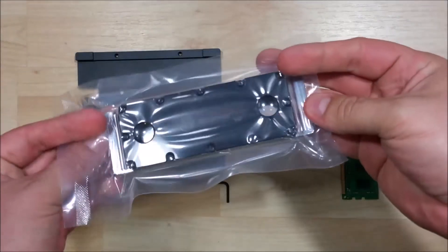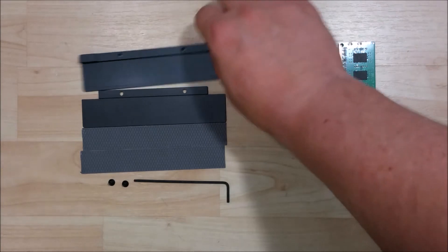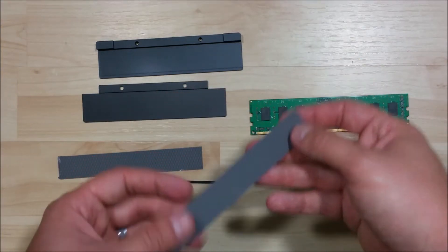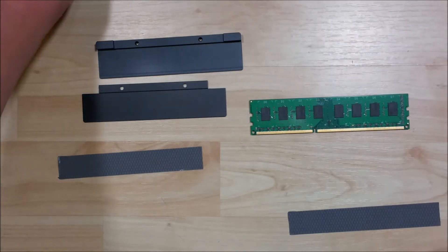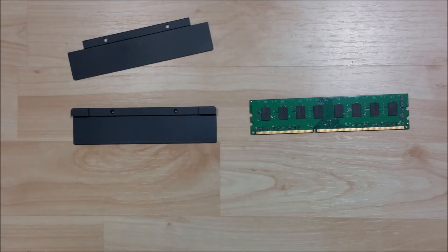Here is the top of the block itself where the fittings go in, and then where this makes contact to the top of this housing for the RAM. You can see right here we have our new thermal pads — we're just going to rip the backing off and lay it on top. We have our two screws to go ahead and clamp this back together, and Bitspower did include a small allen screwdriver. The first step is to put the RAM into the female portion of the housing.